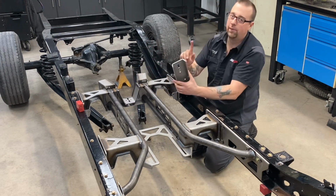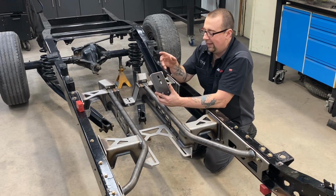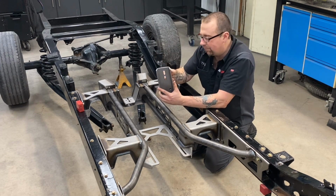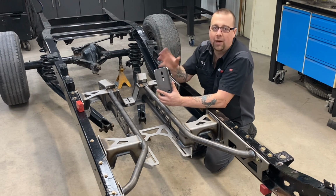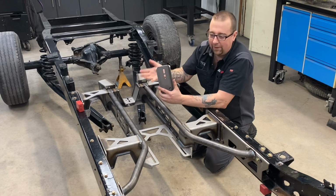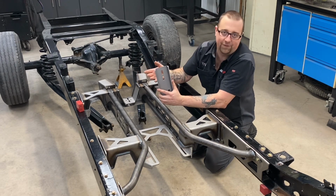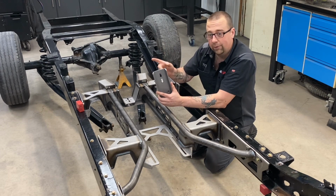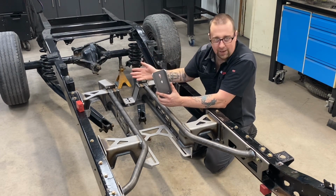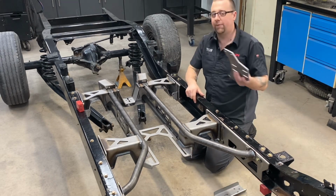Now, take note of this, that you're going to have to use the eyelet style inline bolt hole drive shaft hanger bearing for both. And we would recommend you get one of the aftermarket billet ones. They're stronger, they're going to take a lot more stress than the factory style, but you can use that hanger bearing for both drive shafts. On top of that, we'll talk here about our transmission cross member.